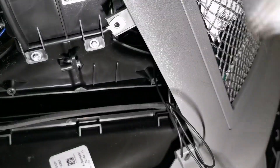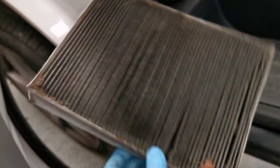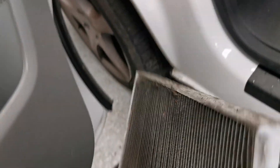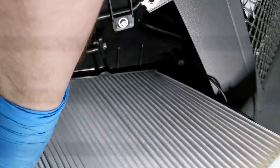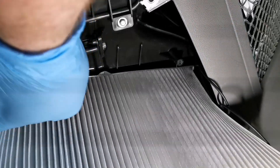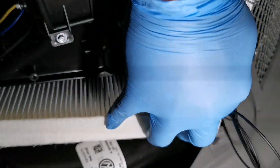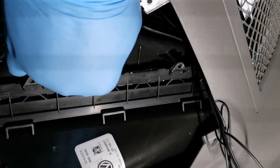This is what filters the air coming inside the car, so if it hasn't been changed in a while and has build-up, it won't filter the air properly and can cause a bad smell coming through your vents. The new filter easily slots in place, but make sure you check the markings on the side so you can put it in line with the flow of air. Then it's just a case of refitting the plastic cover and the two bolts that hold it on, and then the other plastic cover that hides the housing.